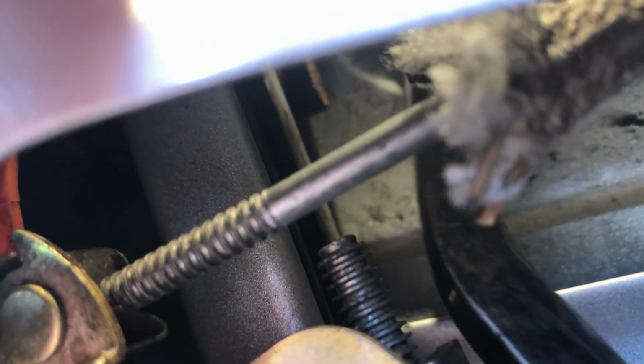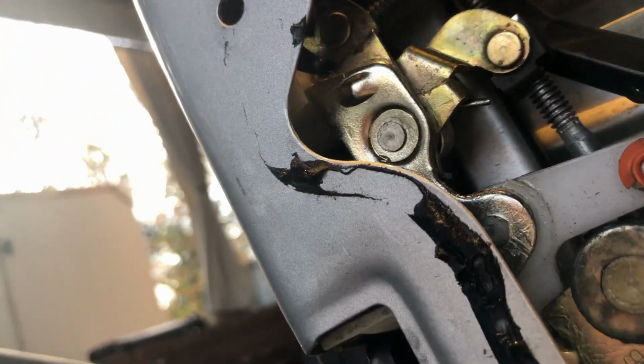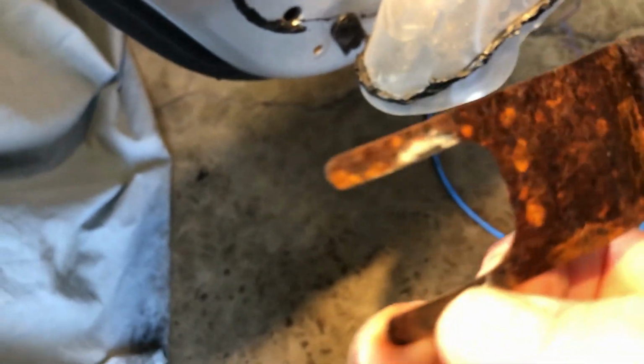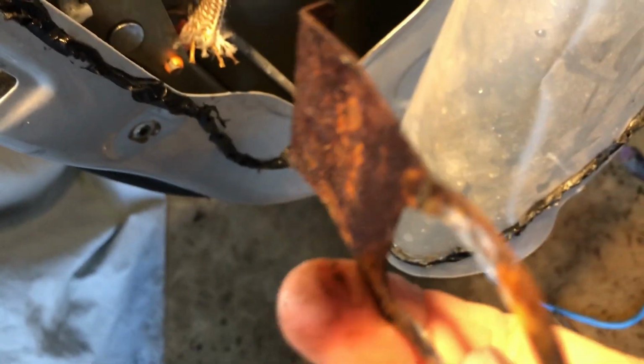So what I did was I took a pry bar. Well, I'm doing this one and got behind it and pulled it out. Like so. Then reach in. Well, it's just gonna fall in the door. And this is what you get out, which is what holds your lock cylinder in place, okay? Then you can come around here and pull. Now again, doing this with an iPhone.